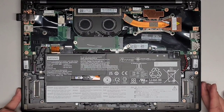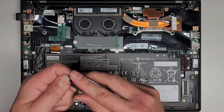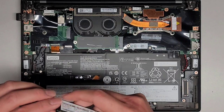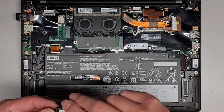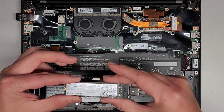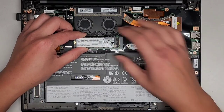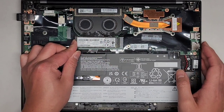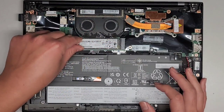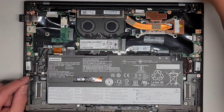I'm back. So we've got the SSD now copied to an external drive. That way, if any data is missing, we'll be able to pull that out and put it onto the computer once we reinstall Windows. We'll take the drive out of the adapter and put it back in. It goes at an angle and then you push it in — it should slide in quite far and then it kind of locks in place because the raised part goes into that little groove.